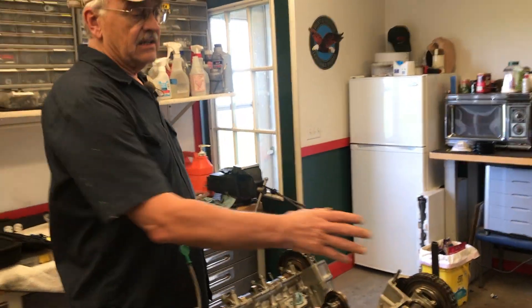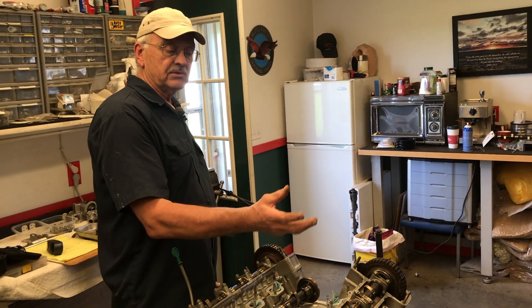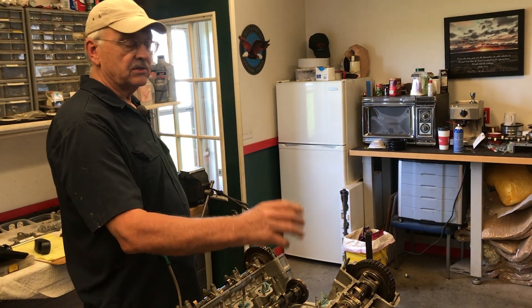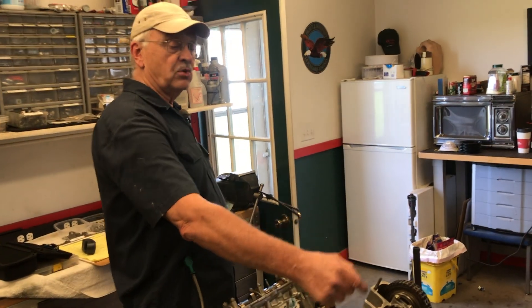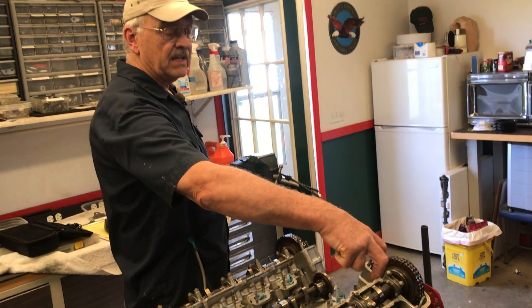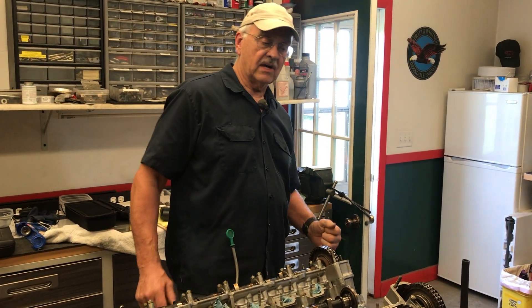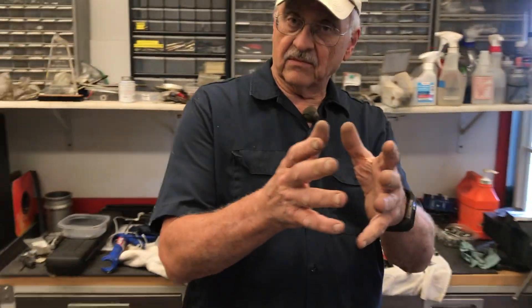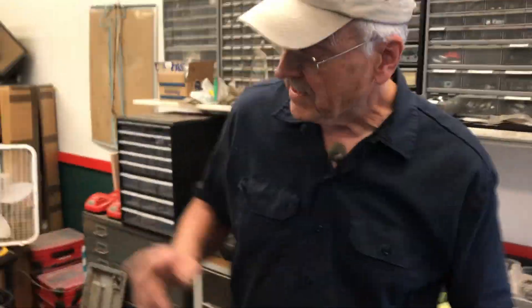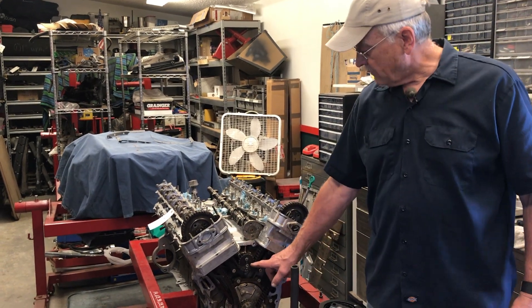To give you a little insight as to how I made sure that A1 was at zero degrees: when I did the valve seals I got A1 to top of its travel, used a valve on top of the piston as a pushrod to drive a dial indicator so I could simply turn the crankshaft and get the piston on A1 to top dead center. I then installed this tool on the back.